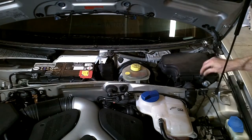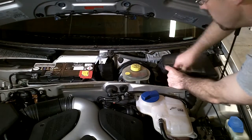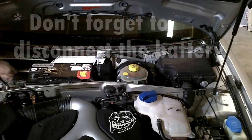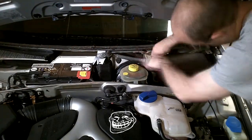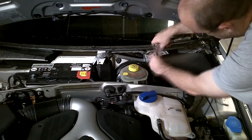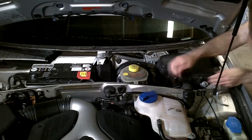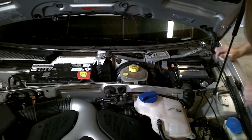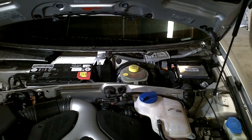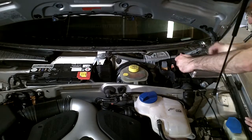I bought this chip used off of eBay. I'm going to post a link in the description below showing a compatibility chart for different ECUs for different years, makes, and models of the Audi S4. My car is an AA box, this is an L box, and it should swap right over. They both require the Hitachi mass airflow sensor, and it's just five bolts to get into the ECU box.